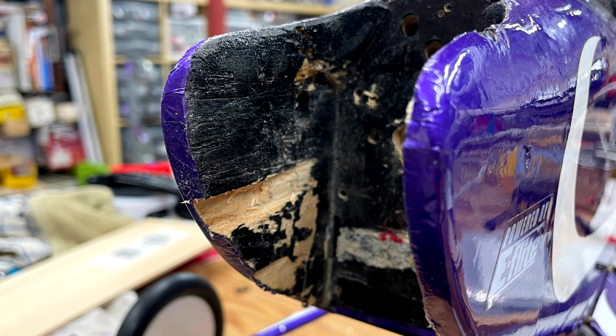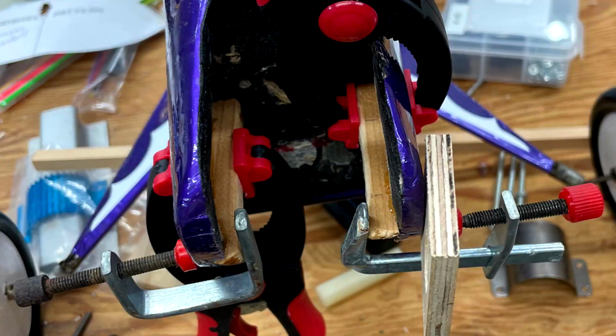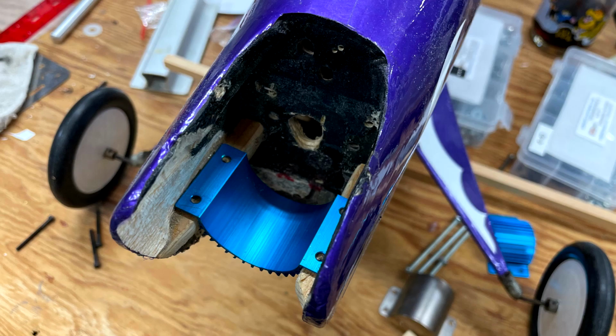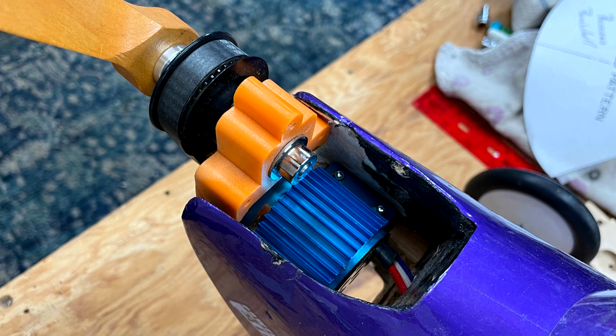and just put some hardwood beams in there, and then use a clamshell motor mount, probably easier to see on the bottom, a clamshell mount that holds the motor in. So that's what's going on there. And originally, when I had that installed, you really had to cinch down on that thing to hold it. And this is a 13-inch prop on here, a lot of torque. Not only was it twisting a little bit, the motor was trying to pull out of the mount.